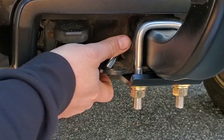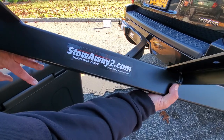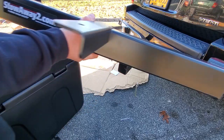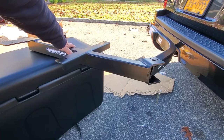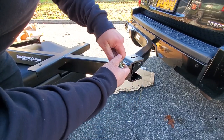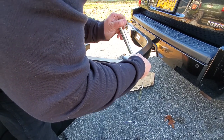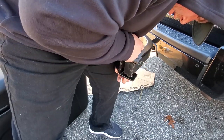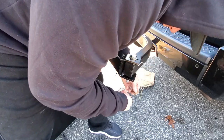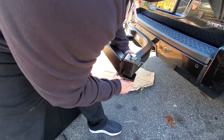While I have easy access, I'm just going to slide in my wire adapter. There we go. Let us now attach our swing arm. My guess is that the Stowaway 2 is in the back right side up, so I think it's safe to say you can just drop this arm right here. I'm using the Stowaway itself as a prop. This is a big bolt — one bolt on the top, one bolt in the middle. It's like a swing arm sandwich. Last washer on the bottom, a nylon lock washer, so this won't come off.